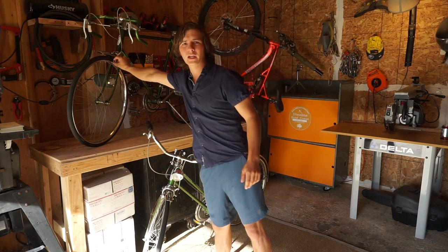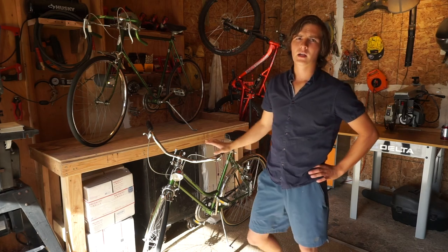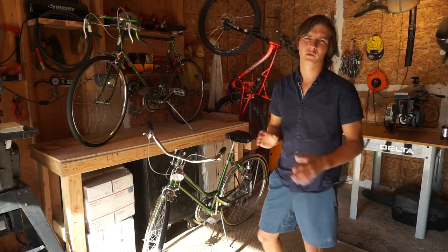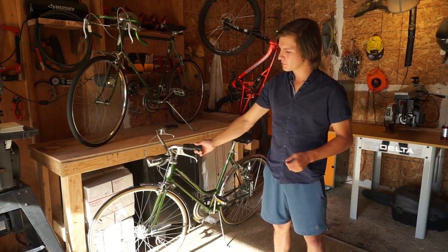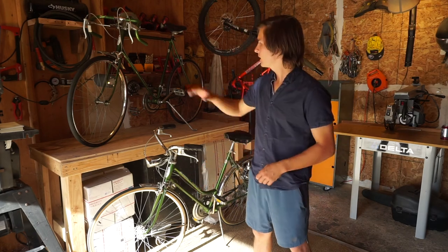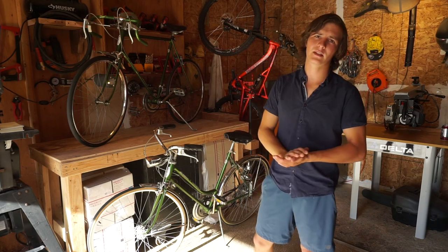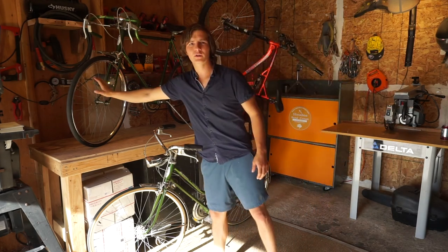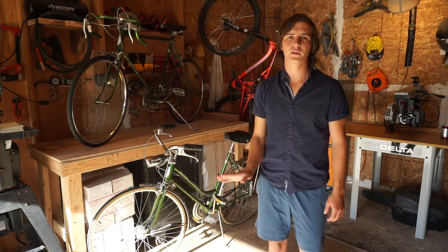We're probably going to have to replace the brake pads. I'm going to try to find some original Schwinn spokes, but they're pretty hard to find, so we might have to go with just some generic spokes for this one. The spokes on this one are rusted, but this one was kept a lot better — I think it was inside most of its time. So basically, this one we're going to be tuning the spokes, and this one we're going to be re-spoked completely, so you're going to learn how to do both of those things.